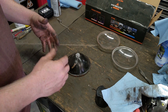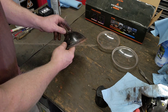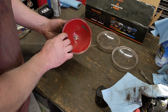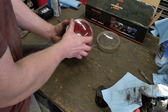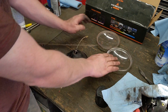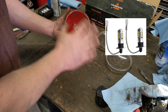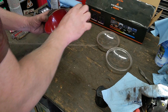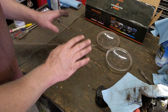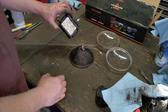The problem is LED has one major flaw: it only likes to put light out in one direction — straight out. All these aftermarket LED H3 bulbs have to fit through a little hole to slide in from the back, because many housings don't have a removable front cover. So manufacturers put LEDs on the sides to try to reflect off the housing, and you get horrible beam patterns — splotchiness. You can buy a bulb for 10, 15, 20 bucks and it just looks horrid, very distracting.